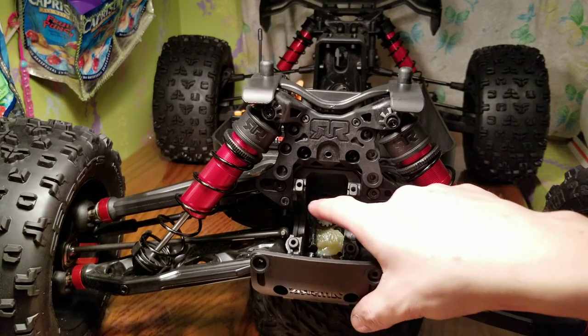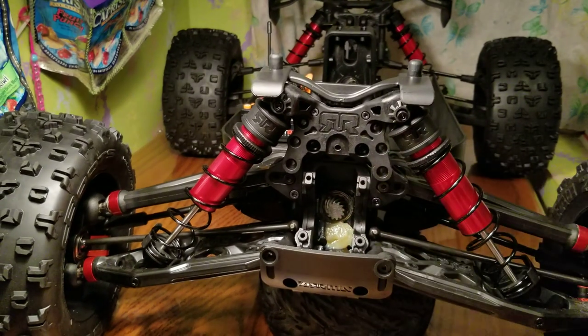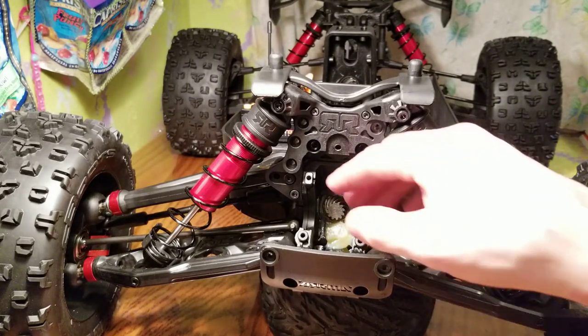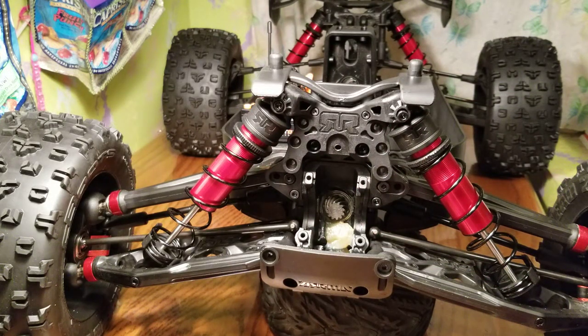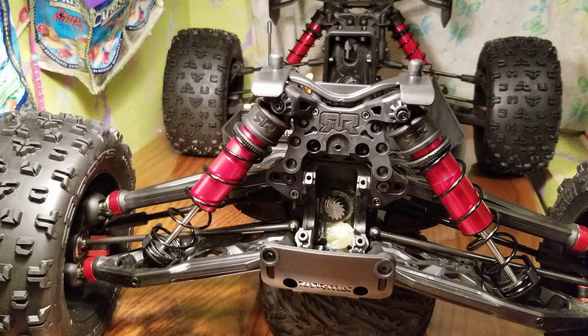You could take a can of brake cleaner — since this is really thin grease — and spray it all out real good to clean everything. Just make sure you use compressed air from an air compressor to blow all the residue out. Brake cleaner air-dries, sure, but make sure you get all the residue out because you don't want that mixing with your new grease.